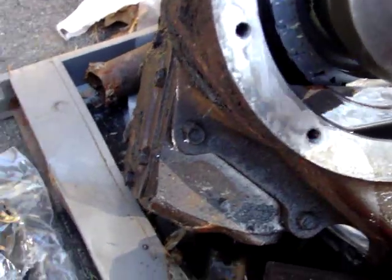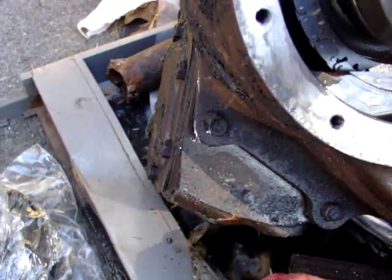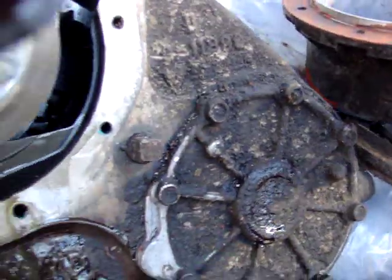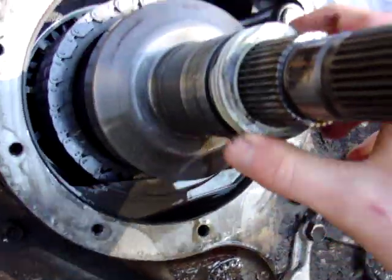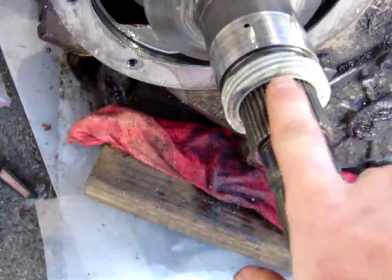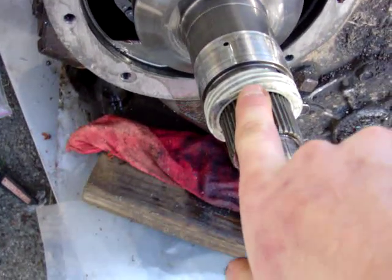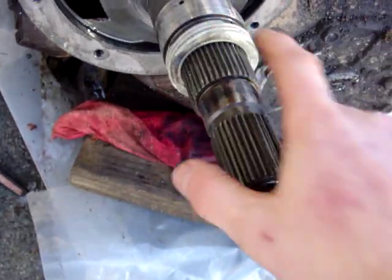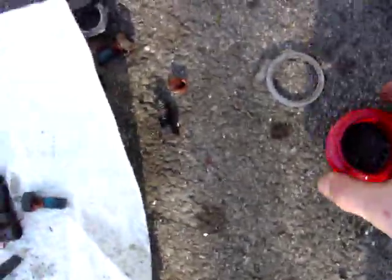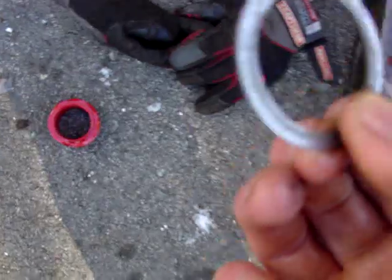Then you're ready to pull off the differential and shaft pieces and put on your new shaft — it just slides right over. There are splines on there, it just slides right on. Then you put this back on over it. This shaft already has the replacement plastic oil drive gear on it, so then this housing slides over that.